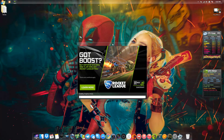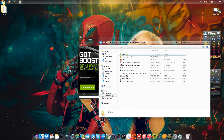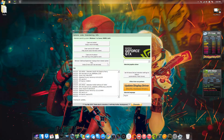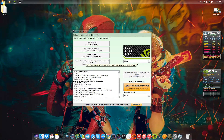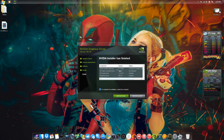If you have installation issues, download a program called DDU — Display Driver Uninstaller. Launch it, choose 'Clean and Restart' and remove GeForce Experience as well. This completely wipes all Nvidia drivers so you can install fresh. If the drivers don't apply correctly after a reboot, use DDU first and then reinstall. Once installation is finished, press Restart.